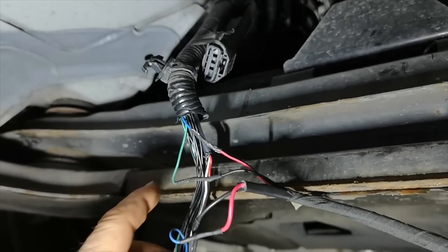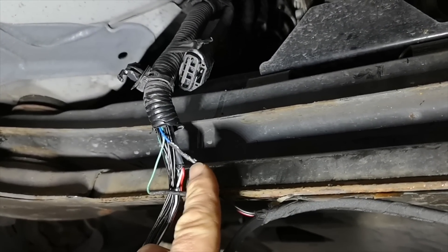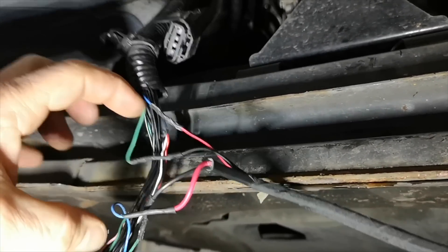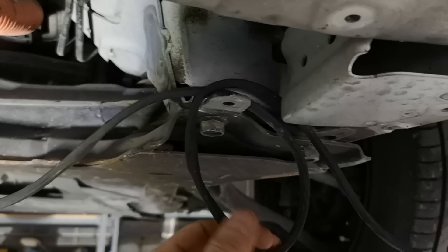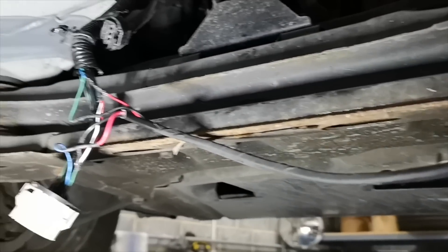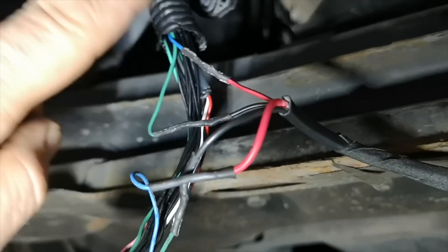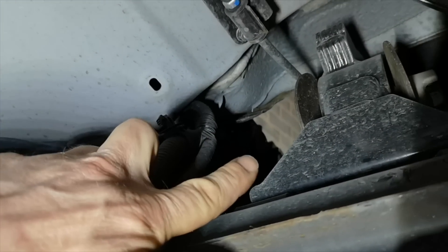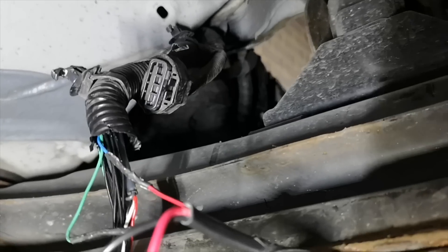In here you can see I've wired the CAN line up and the CAN line back — that's going to be our interruption in the lines — and my wiring loom is just hanging up here. Sorry about the camera, it's my mobile phone. Now I'm going to tie this off up here, feed it up there, through the bulkhead further up, into the cab, and then start working up in the cab.